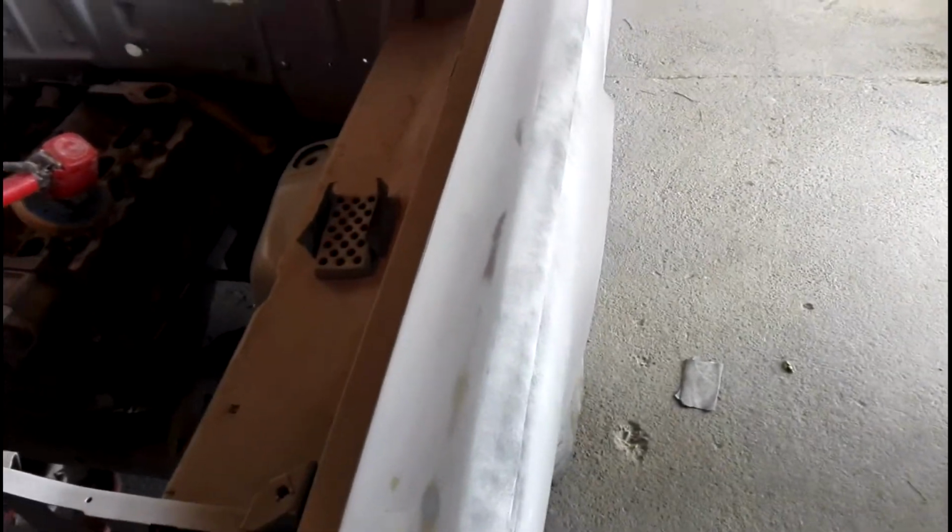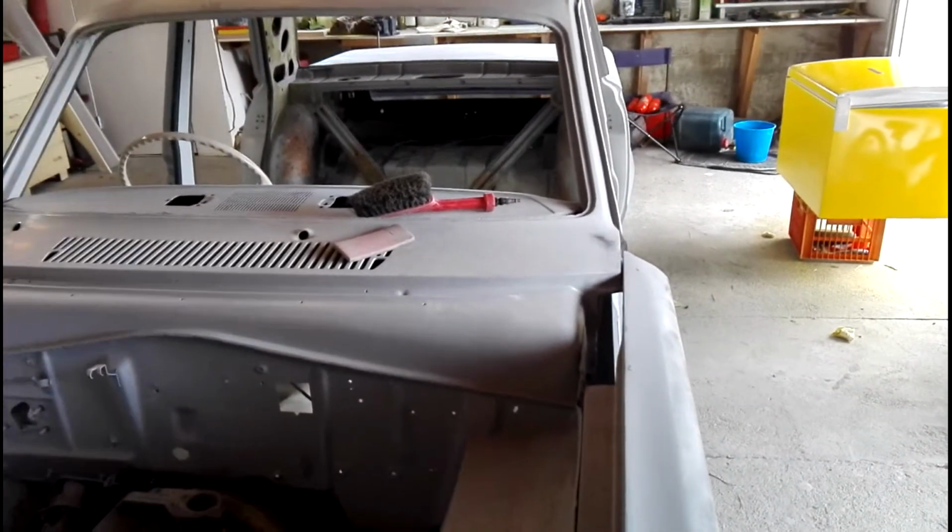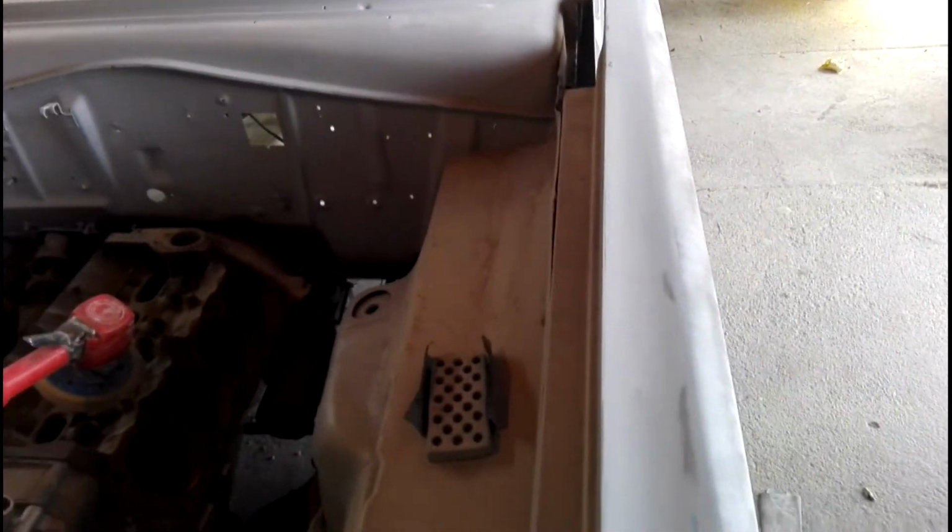It probably doesn't hurt to do the odd long straight sweep occasionally, but try and keep it going backwards and forwards across itself, so you get that nice, even, flat surface as much as you can. I know it's awkward sometimes in those slightly curved areas, but do the best you can. With the longer, bigger flat panels it doesn't matter much. If you're going like that and then like that, it's a nice big, easy, open, flat panel, a piece of cake. Like that boot lid was a piece of cake. It's just a lot of blocking to get it all down to the one level.